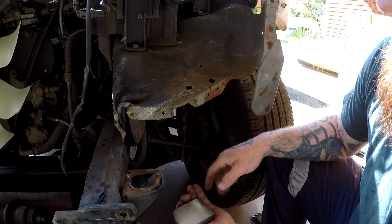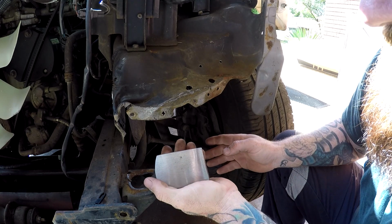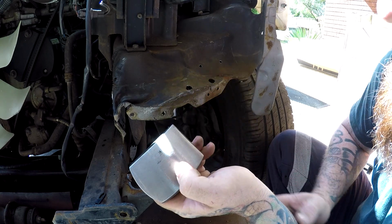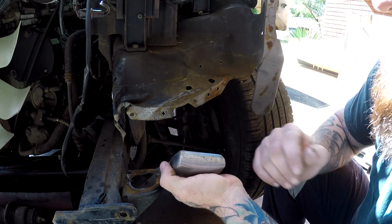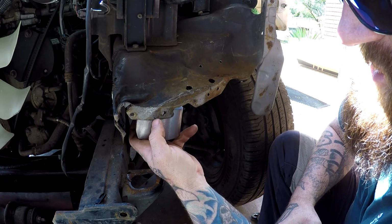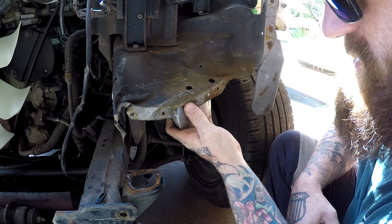So another thing worth mentioning, when you're working with curved areas, as I said, there's no perfect dolly for any scenario, but find one close to the radius you want it to be. So if you're working on a fairly flat surface and you start getting towards the end when you're going to start planishing and shaping that way, try and find one that's fairly close to the radius you want. It's got the same crown is what you're playing with.